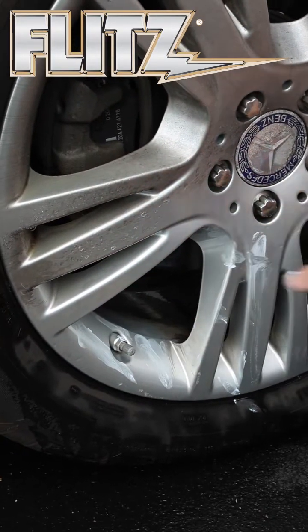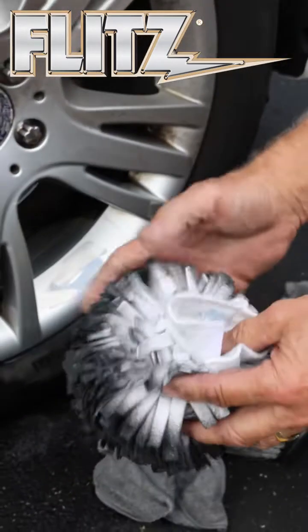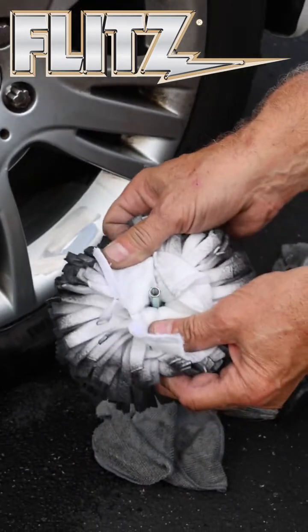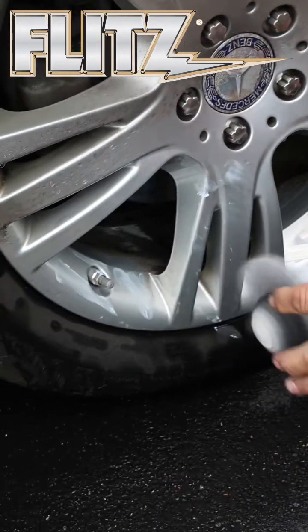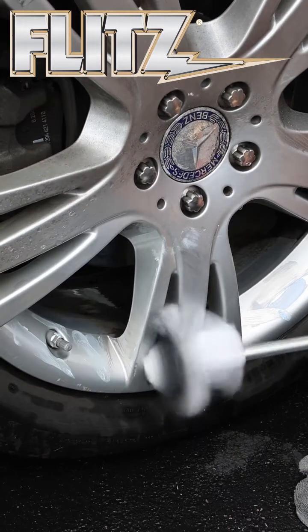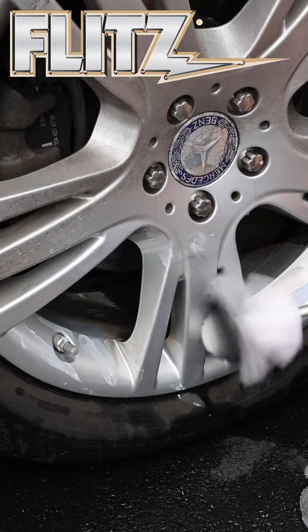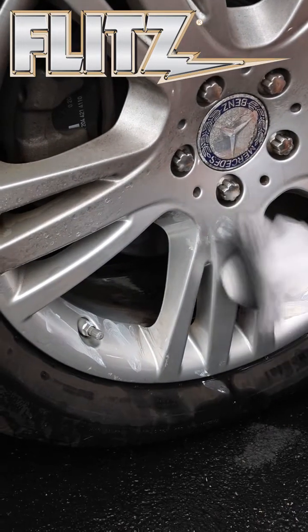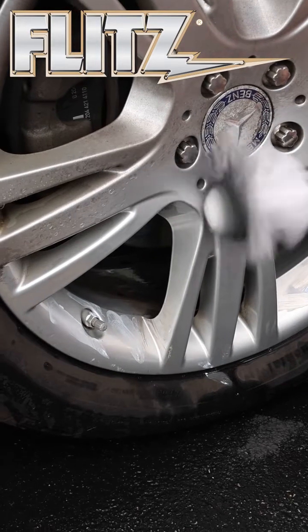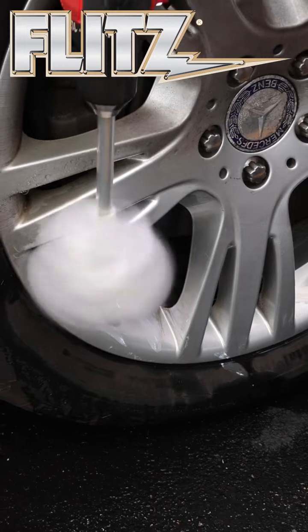Now since we've been demonstrating here and polishing, we use buffing devices like this. This is a 5 to 7 inch buffer. There's a shaft built in the back. This is a 2-inch buffer. This one's actually designed more to get in a hole. If you notice these little flippers over here, you can use them right inside like that. There's plastic on the shaft, so if you have to hit something, you're not going to harm it. It'll get in all the tight areas, right around your lug nuts and things. And you can see how it works right like this inside.